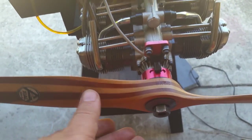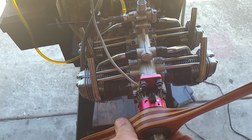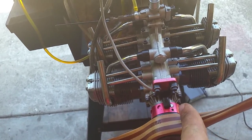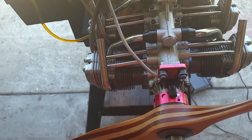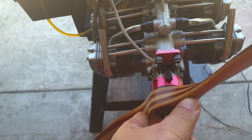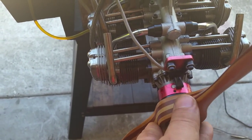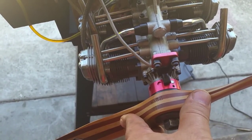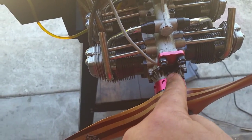You want to be at 30 degrees and the system buzzes when the magnet edge reaches the sensor — right there where you see it. That's 30 degrees before top dead center, not when the magnet leaves. So the timing is 30 degrees before top dead center when the magnet gets in touch with the sensor.